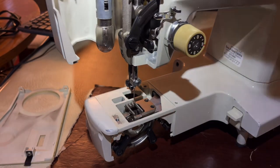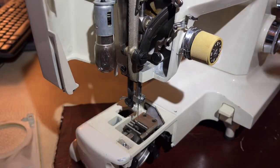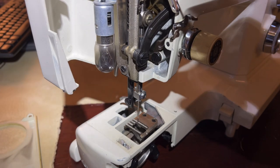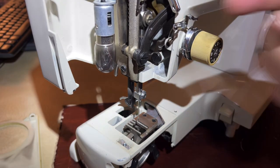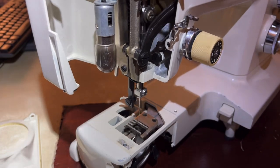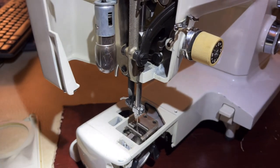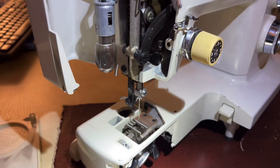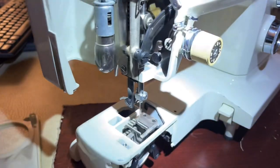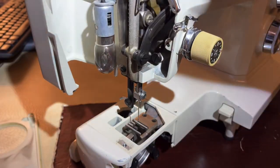Right here - I put a drop or two, I'll put one more now. That shaft is what the needle bar mechanism is basically hovering back and forth on. A lot of times when you have a zigzag that's stuck it's because that bar is actually stuck, because not everyone uses zigzag all the time. A lot of people would just use straight stitch. We often buy things because they have all kinds of functions and cool features but we don't always use them all.